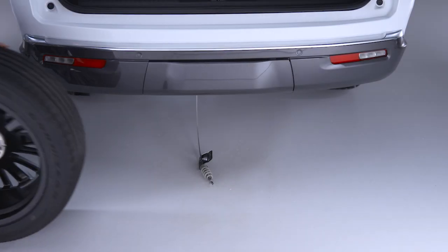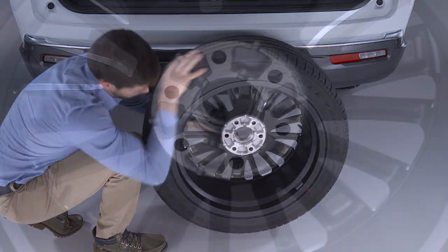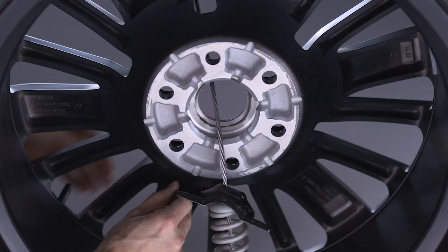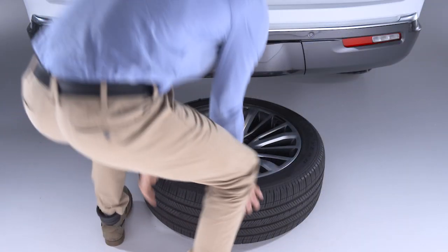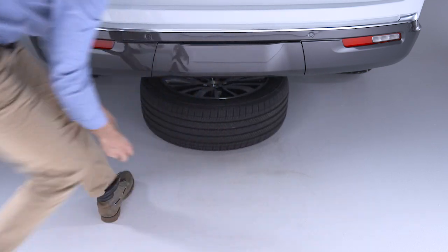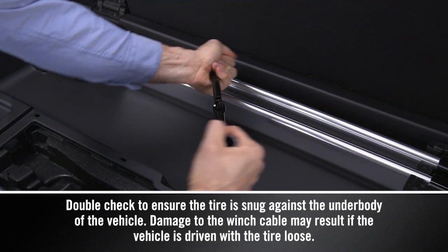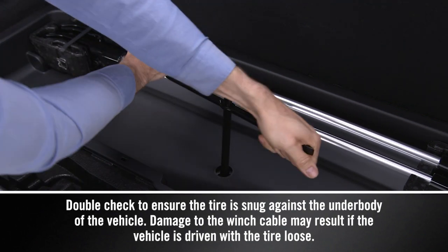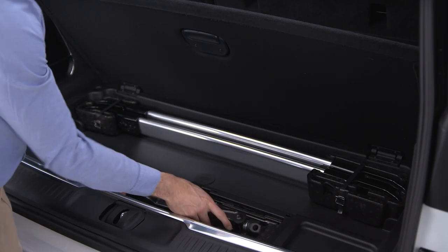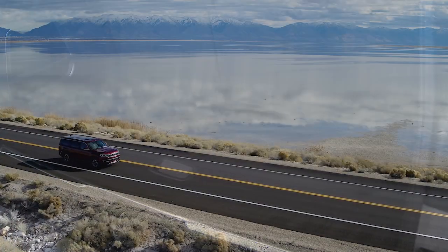To secure the damaged tire, position the wheel behind the rear bumper facing inward. Then push the end of the winch's cable, spring, and steel sleeve through the hole. Make sure the back of the road wheel is facing the ground and slide it until it is directly under the winch. Raise the tire by turning the lug wrench on the winch extension clockwise until it clicks three times to make sure the cable is tight. Now just secure the jack and tools in their proper locations and you're ready to go.